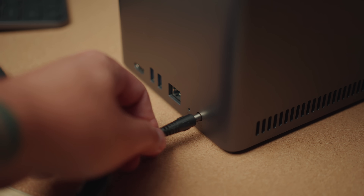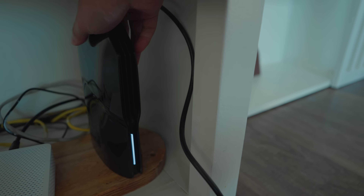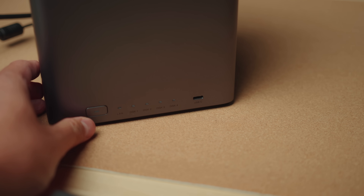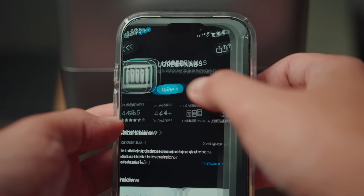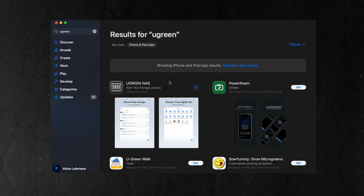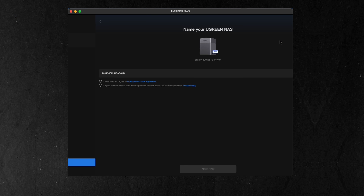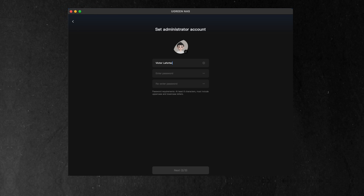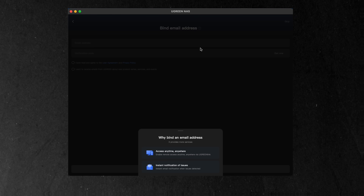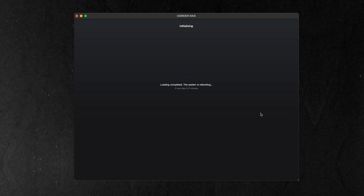Plug in the power and the ethernet cable. You have to connect the NAS to your main internet router to get the best upload and download speeds from your internet provider. After you plug it into your network, press the power button and it should start up. You can do the setup with your phone by placing it on the NFC chip, and a link should pop up to download the Ugreen app. You can also do this on your laptop — it's the exact same as the mobile version. Select new device registration and the NAS should show up. Change the name of your NAS if you'd like and click next. Create your administrator account — this is what you'll use to access your NAS from your phone or computer. You can also bind an email address for remote access. The NAS setup takes about five to ten minutes including reboot.